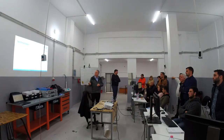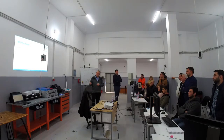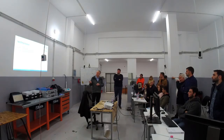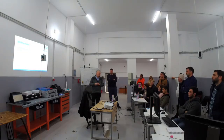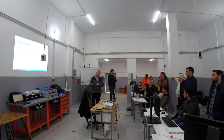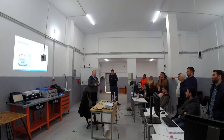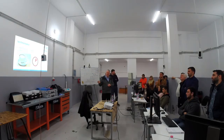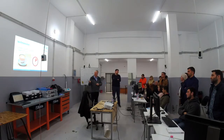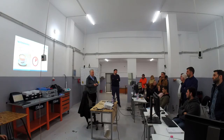So we already talked about the capacitors. We talked about them a week ago, and we said the capacitors should be left 10 minutes to discharge. And we already know that the capacitors need some time to discharge the accumulated energy. So this time it might be time to take a coffee, for example. In that time you can do other work or simply have a coffee. Anyway, we have to wait about 10 minutes for the energy to discharge. It depends on the capacitors, it depends on the cars, and again, we will have a look at the manufacturer's instructions.